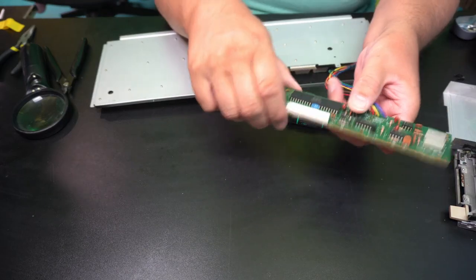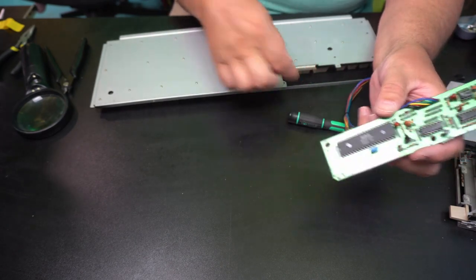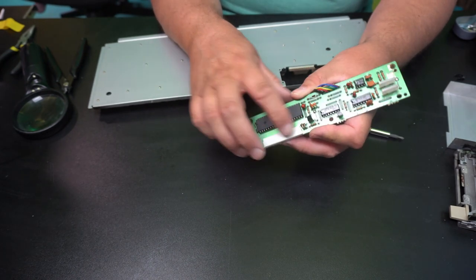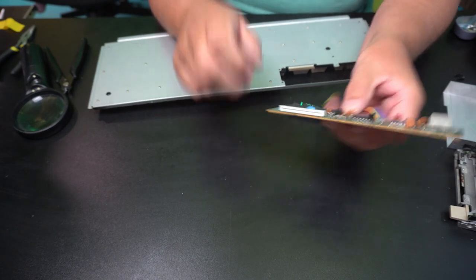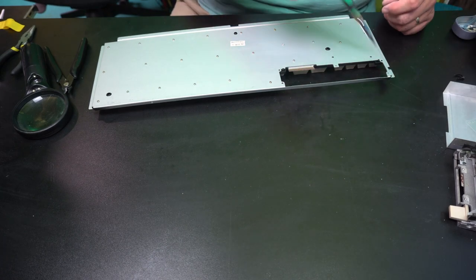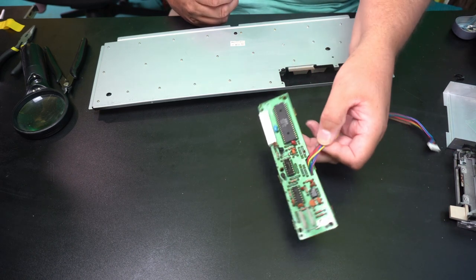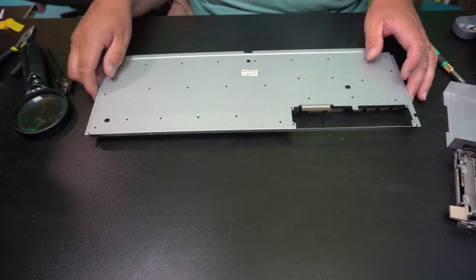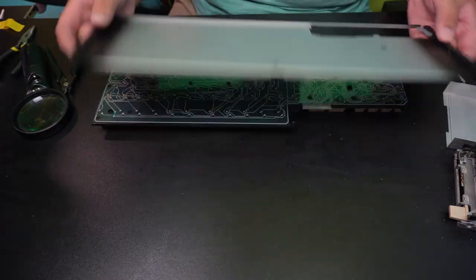And if you're gonna take the keyboard controller off, it's got this flat cable. And then to be able to release it, you just push this forward — and it actually moves quite easily. Sometimes these also could create connection problems. And then you take the other screws out, and then it comes out as a complete unit. That's where all the screws should be out — and then it just lifts off. And that's the back side of it.